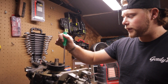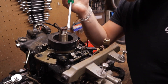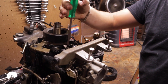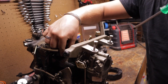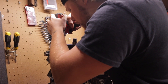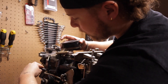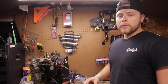Once the stator is off, you have the timing advance assembly at the bottom. There are three tabs, each with a flat head screw on top. Crack those off, pull the three out, and this whole assembly pops up, exposing the top of the crank. Pull your wiring harness from behind the throttle lever and set this assembly aside.